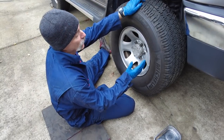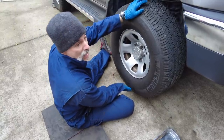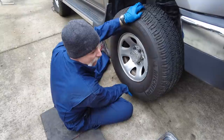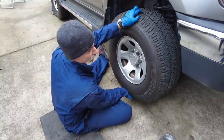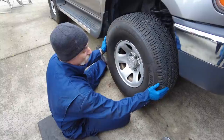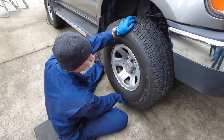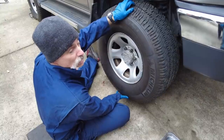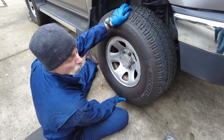When you're checking for wheel bearing play, grab the wheel at the 12 o'clock and 6 o'clock positions and push and pull with opposing force. If you feel play, that's wheel bearing play — your wheel should not be moving and you shouldn't be hearing anything. Grabbing it side to side is more like checking for steering play. Rock it at 12 and 6, and you'll feel and most likely also hear it knocking. That's a dead giveaway the wheel bearing is wasted.